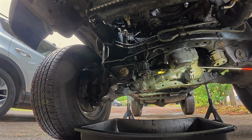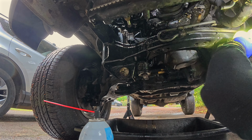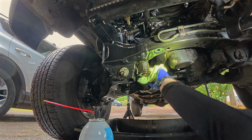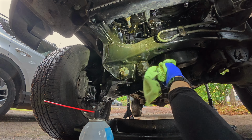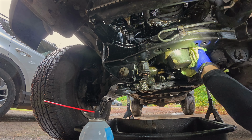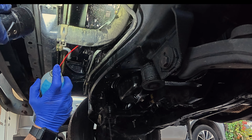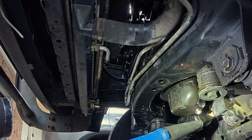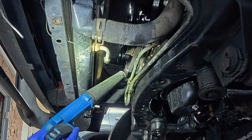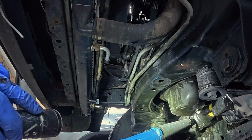When your car is leaking oil and you're driving down the road, you're basically just blowing oil all over the place. So it's impossible to diagnose without doing a cleanup. Definitely have a sacrifice rag to take off the big chunks. This may seem absolutely hopeless, but wait till you see the end. Here's the process: brake cleaner, respirator, and then use the leaf blower to dry things off. Remember, we're cleaning up the engine to diagnose, not cleaning the actual car.